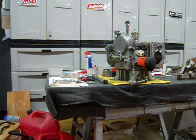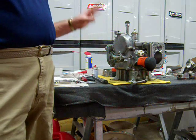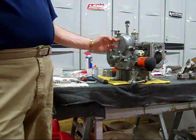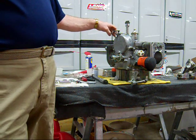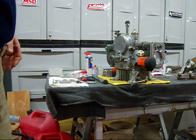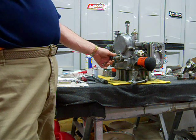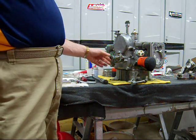Over the next few days I'm going to start getting the upper tin painted, get all the manifold done, get the flywheel on, stator and flywheel painted, and start working toward getting all that stuff installed. I'll adjust the valves at that point when I can line up the timing marks on the gear cover. The other thing — when I hooked this up the governor works good; you can see it throw that arm right over. The drill motor idea is pretty good for running it — if that little drill motor can turn it over, the starter surely will, especially with a big flywheel like that providing leverage.